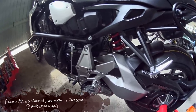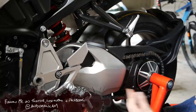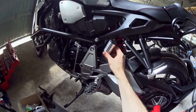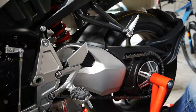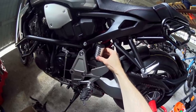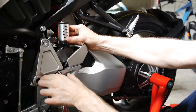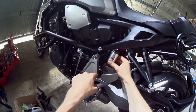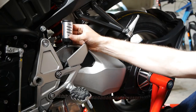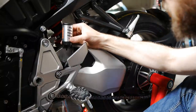The first thing to think about is where it's going to go. We don't want to mount it anywhere where the swing arm can hit it, since this great big silver chunk of metal is obviously going to be jumping up and down while the bike's being ridden. It also needs to be vertical, although it can be mounted a maximum of 13 degrees from vertical. We need a position that's out of the way so I can't kick it, but also accessible so we can get the lid off to fill it up. I'm thinking roughly here — it's a pretty good position, protected by the heel plate, and the swing arm won't be moving much because we're just a couple of inches from the pivot point.